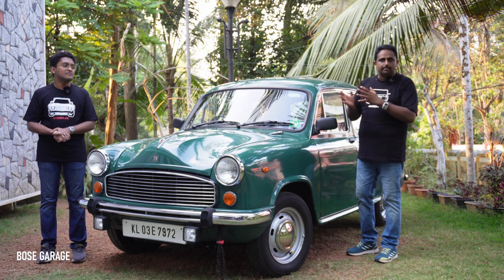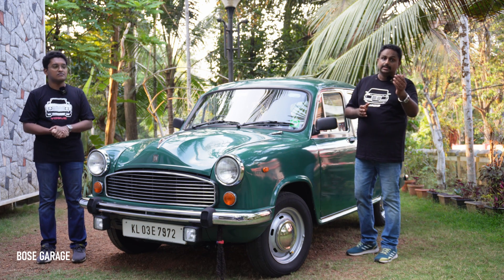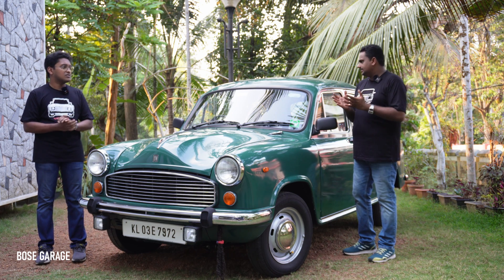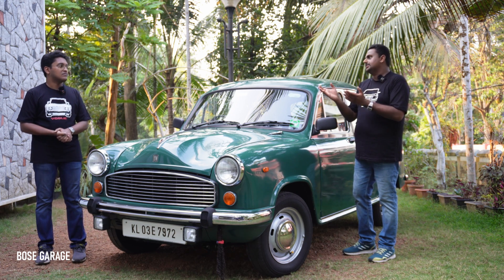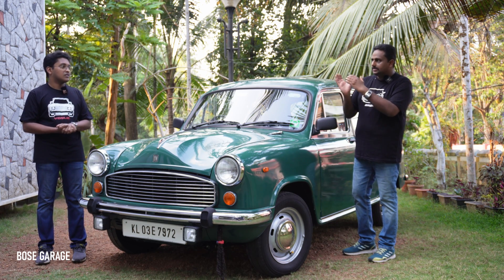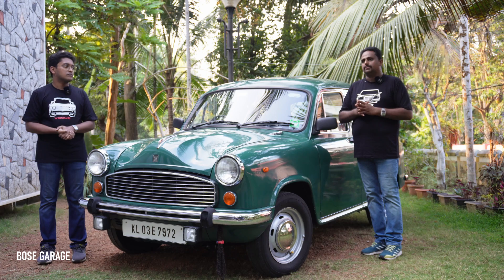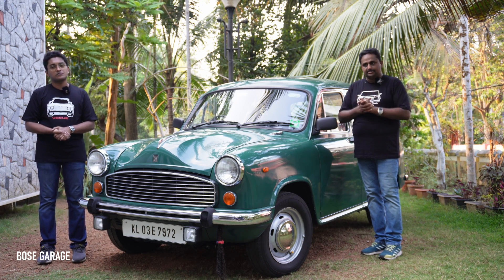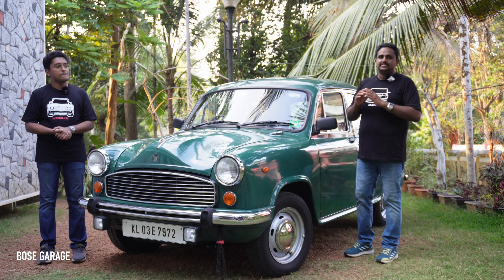People think that Ambassador parts are not available, but most of the Ambassador spare parts are still in production by sub-vendors. HM Genuine parts are hard to find — they are almost non-existent, all exhausted. However, some engine parts are still made by AV Tech of the CK Birla Group as genuine spares. All three suspension bush kit brands are available, so if you don't find it at your nearby shop, other vendors will likely have it in stock. Make sure you rebuild the suspension on time because a worn-out bush kit will eat away your tires — even with periodic alignment, with a worn-out bush kit your tires are gone.